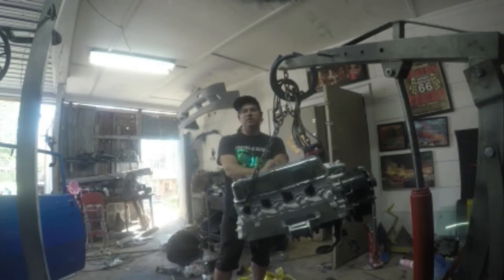As far as the rear end, y'all saw me when I got that rear end built. If not, you can go back to the videos on this playlist of the Maverick restoration. You'll see where I got the rear end for free and chopped it, narrowed it, and did that. There's a few episodes there. But that is an 8.8 rear end out of an '89 F-150 that has a 5.0 in it. So it's an 8.8, 3.73, limited slip.